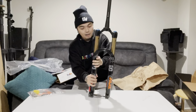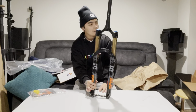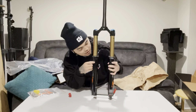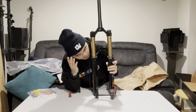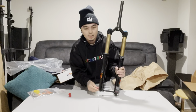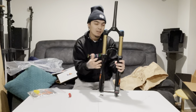As you can see, obviously, the inner stanchions — this one right here is 38mm. The thickness is 38. And then right here, if you see these things — I forgot what it's called — but what this does is, if you go into higher elevation trails, there's air stuck in down your lower stanchion. So what you do is just press this once and it releases. Almost like you're bleeding a brake — you want all the bubbles to get out. It's almost the same concept, in order for you to have the full performance of your fork.